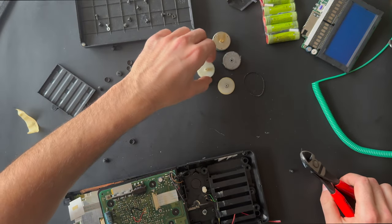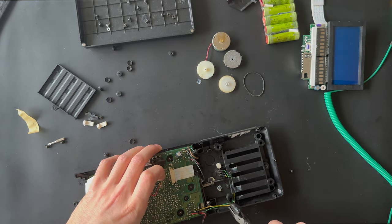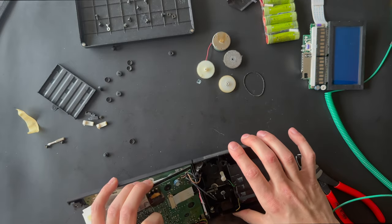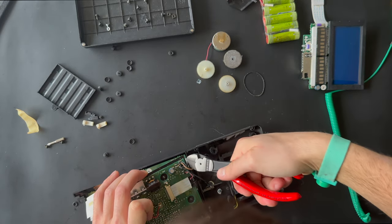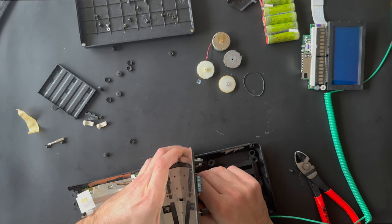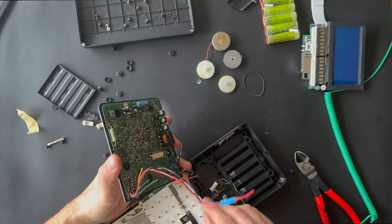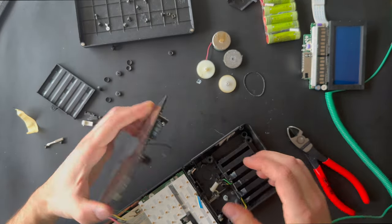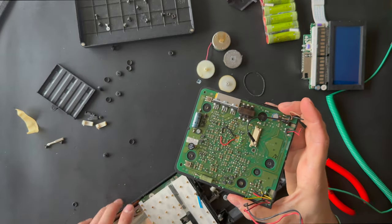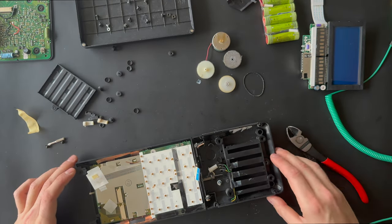Let's disconnect the motor — the gear motor. We can disconnect the wire for the battery and disconnect the ground. We're also going to remove the flex cable — it's just glued. There we go — disconnect. Here we go. This is the plate with the touch sensor for activating the Beolink 7000. Next step is to remove the main board.